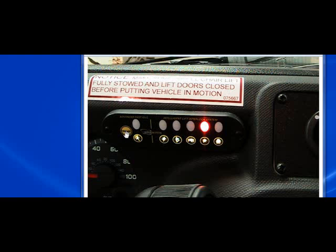There's only one active button on this entire panel and that is the engage button. This button serves several purposes. Number one, if the vehicle is not in fast idle and you wish to engage it manually, the vehicle has to be in park, and then if you press this button it will manually put it into fast idle.